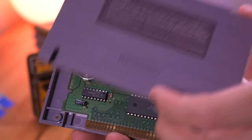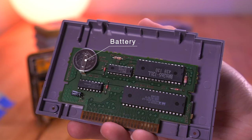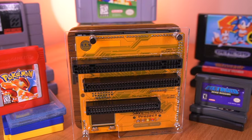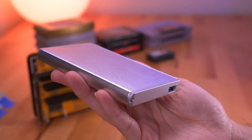More importantly, it's for backing up your save files. Many cartridge-based games utilize volatile memory to store save data, which requires a battery to maintain that data. As these cartridges age, the internal battery will eventually die along with your save data. That's where a device like this comes in handy. This allows you to download your save data from the cartridge and store it on your computer or external hard drive, which utilizes non-volatile memory. This is a much safer medium for storage, since it doesn't rely on a battery.